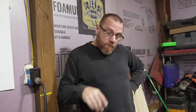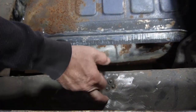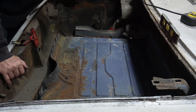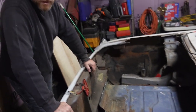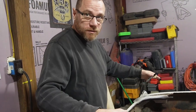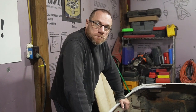That Malibu tank is a really nice shape. We can put that in here, take a tube cutter around it, then rotate the angle on it. We'll literally just cut this and drop it down to the right level and reuse that one — it's a little bigger but it kind of mirrors nicely. We'll refabricate this area and weld everything back together again. That'll give you a good size trunk with lots of airflow, so if you run it in less than ideal weather we won't have wet spots and won't need to build inner wheel wells. We'll just build a trunk tub and be good to go.